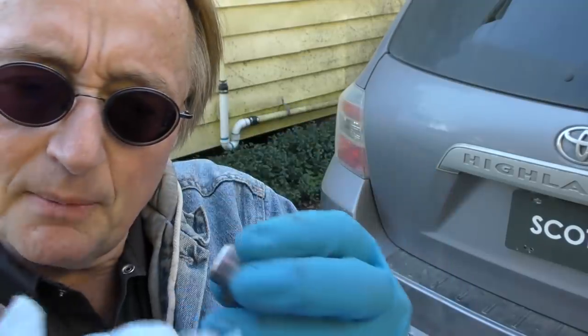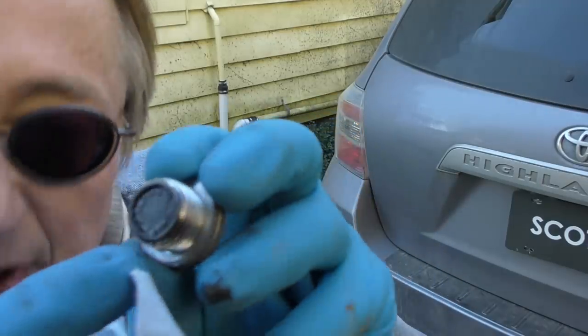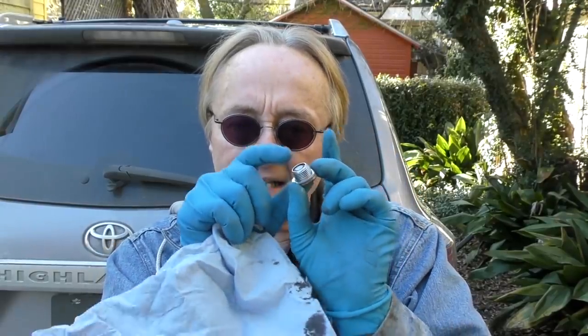We examine the plug - it's got a little magnetic part on it, so there's a tiny amount of metal particles, all that black stuff. You can see those little tiny metal particles if you look closely. Now it's not outrageous, but it does show it's worn, and changing the fluid is going to help it as much as it can - it still might go for years. If this magnet had been covered with big chunks of metal, you'd know it's too late and it's not going to last that long. But since they were just fine little particles, it can still go a while.